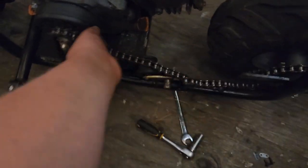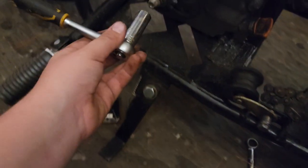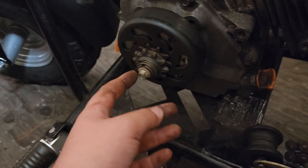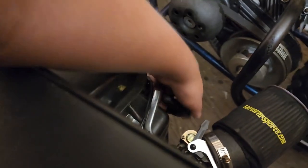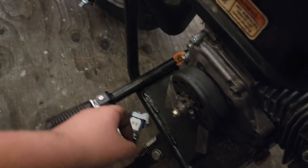I can just pull this chain off — it's nice that it's not falling in the dirt. Now I'm just going to take this off. It is a smaller socket, I think it's a 10. When you don't have a drill on you, what you do is pull on your cable and hit it down. First you want to loosen it with a hammer, then put your socket here, knock it down, and when it starts spinning, twist it off. I did it off camera.